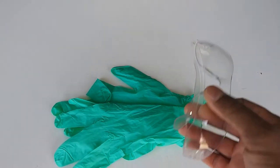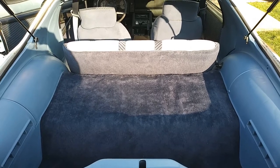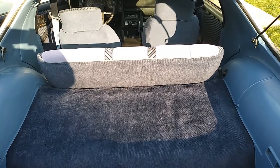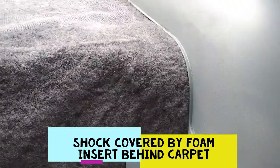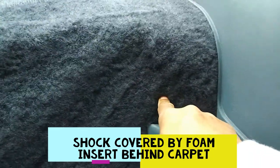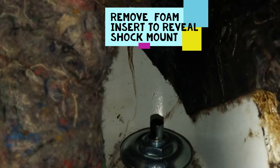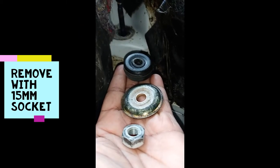As always, before we start working on the car, you want to grab some safety glasses and any other protection you might need. To install the rear shocks, we have to go through the inside of the car. To access the top of the shock mount for the rear shocks, you have to go through this panel here — you may have to remove the panel, or as you'll see what I did, I just folded the carpet over on either side right behind the seat when you lower it. Underneath the panel you will see the top of the shock mounts.